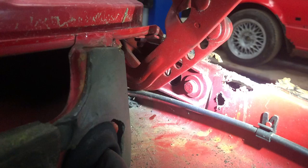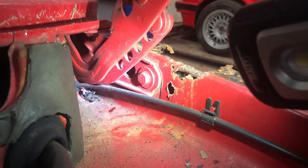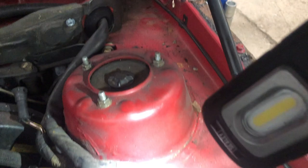You can see that the bonnet hinge bolt area is not too bad, however next to it is right through completely. Normally if you see rust, it's kind of where the bolts go through, so have a really good look at both hinge bolts. If you start to see rust up around the front shock towers, walk away — it can be repaired but you want to make sure whoever does it is doing it properly. The upper strut tower points on this car are actually pretty good.